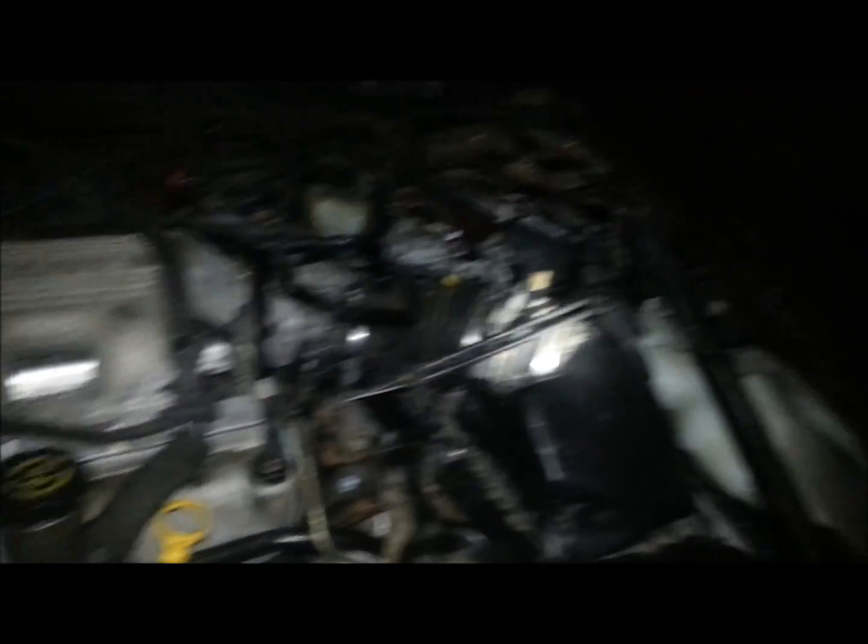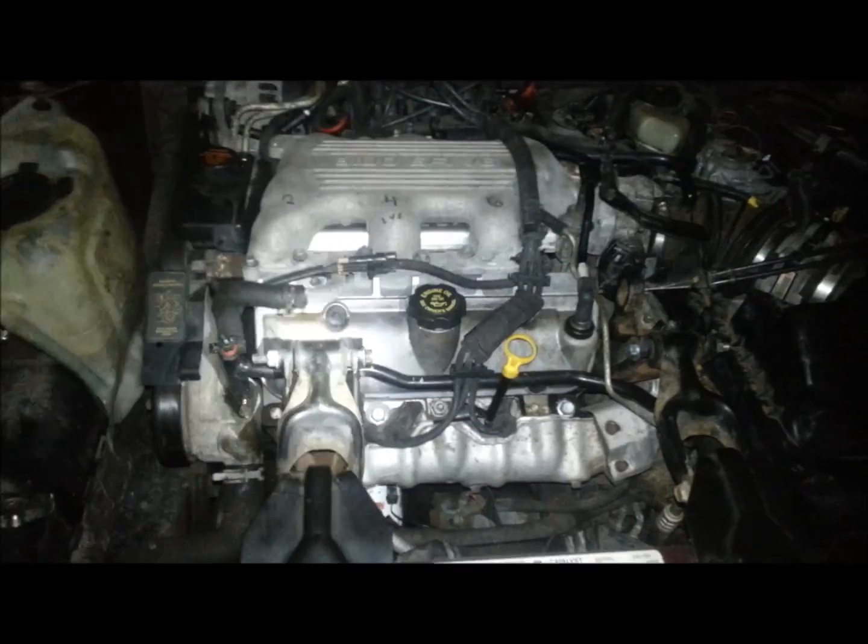Cooling is at the cold line where it should be. We've got a little bit of a seep right there, which is not good. As I'm checking everything else out, nothing seems to be drastically wrong. I've got some dried and frozen coolant — that could be just from where I spilled. Another vacuum line — does anything seem wrong? Nothing's detached. So we're going to go ahead and start it up, check the code, and see what we're getting.